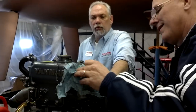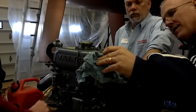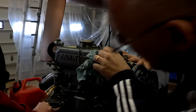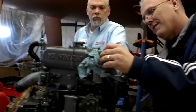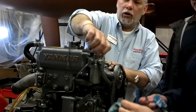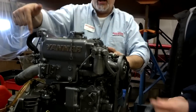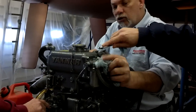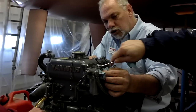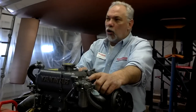So you want to go a little longer than that. Go ahead, pump some. Can you see it going through the tube? It's working. Now that you've got fluid up to here, you can tighten it down — screw it down and turn off a little bit so you're not spraying everywhere. Keep pumping. Once we've got good clean fuel, tighten — snug. That's it. Because this is a steel bolt in aluminum, it's real easy to strip it out, so don't go gorilla tight on it.